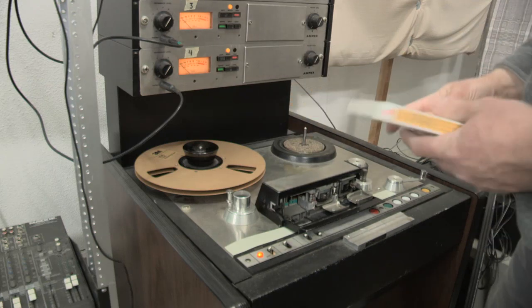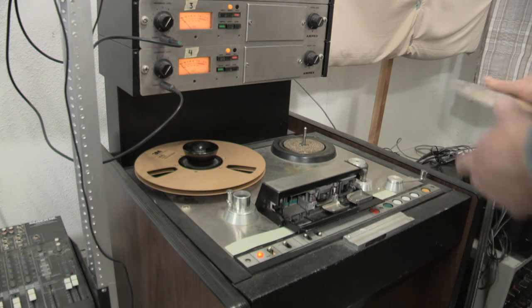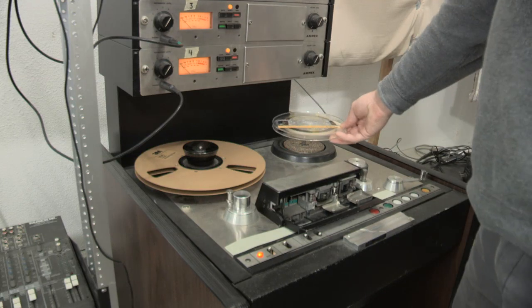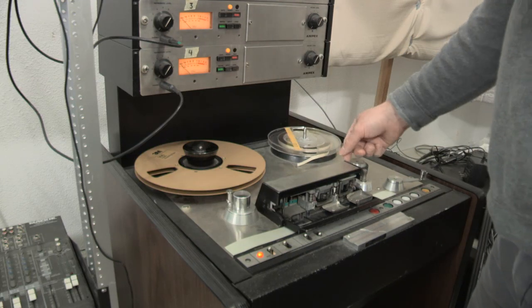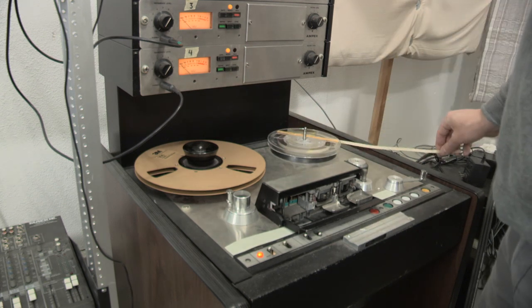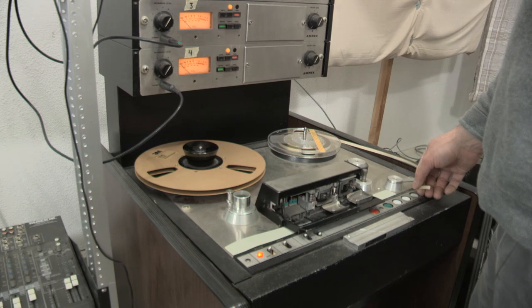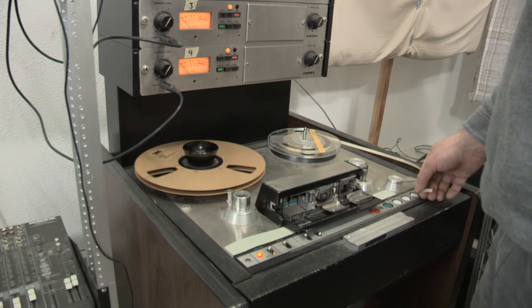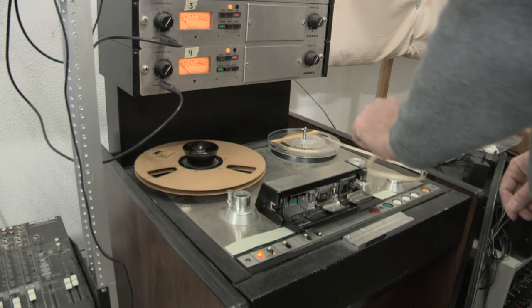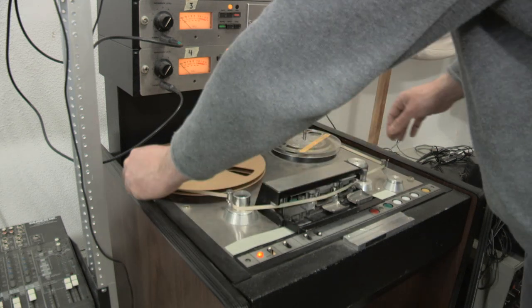Next, I need to put on my MRL tape to make sure that calibration is perfect. It doesn't matter if I used this machine yesterday or six months ago — I always want to run this tape first just to make sure it's in good condition. Now this tape has two songs on it: one recorded at 15 inches per second and the other at seven and a half, which is a little odd. It's not unusual to have 7.5 ips mixes, especially for a demo, but 15 is by far the most common for professional recordings. I'm not going to get into the alignment process here, but rest assured, I do it.